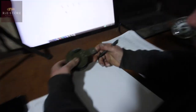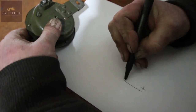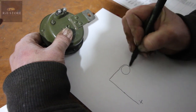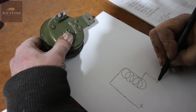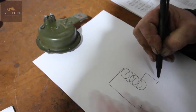Let me get a piece of paper. So you've got power in, power out. That's positive, and that goes in, comes across, and then it goes into a coil of wires and then out to earth. So that's power going all the way through that coil of wires, and that goes to earth. That's your horn button.